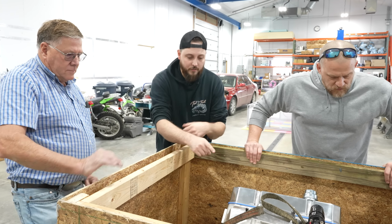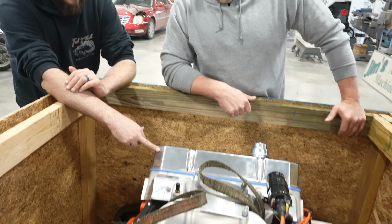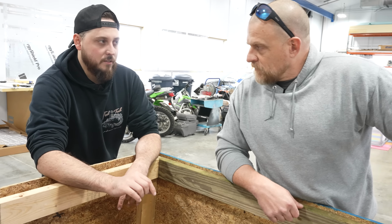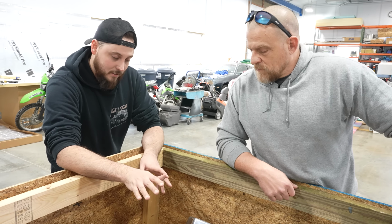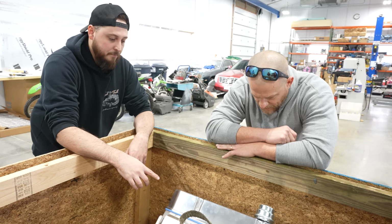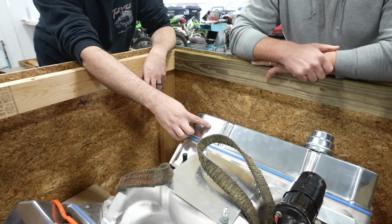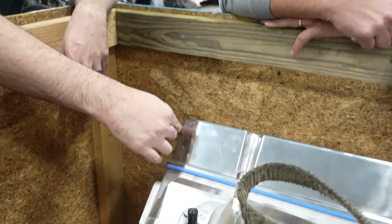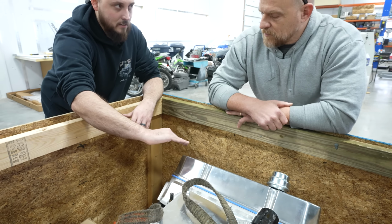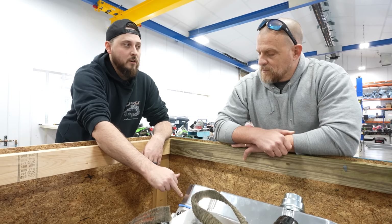A couple things that I did want to go over on this. Originally, I told you I was going to put black valve covers on it. The reason that I didn't paint these black, and I don't know what your preference is, I just thought it was going to look cool with black, but you may have a clearance issue with your brake booster. This is one of those things that we can't tell without having the vehicle here, so until you get it in there, you're not really going to know. But I have seen on the internet, one thing people do is basically cut down the valve cover. Where we have a clearance issue with our rocker arms is actually kind of in this area. It's a width issue, not a height issue, so there's a lot of height that you can decrease here. Again, I don't know, but you may have to potentially find somebody to rework this valve cover.